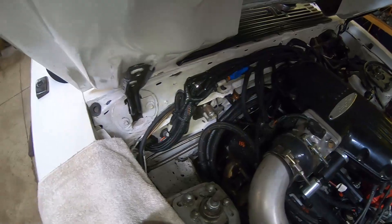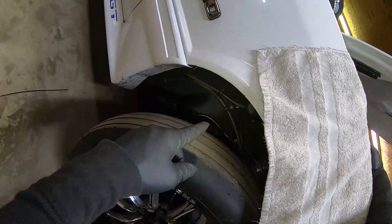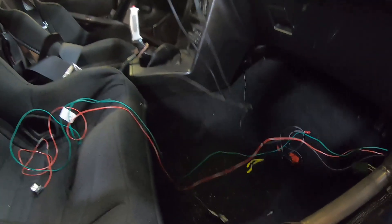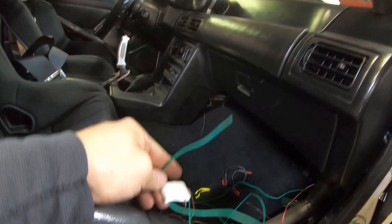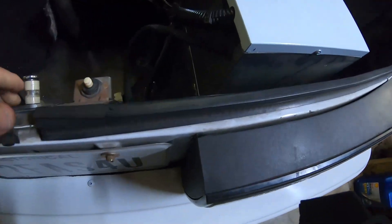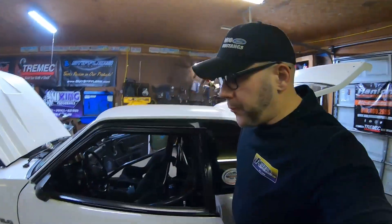Oil pressure — we'll do another low-dollar sensor and run it right here. We have a fuel pressure gauge in the wheel well like on my black car, so we'll run the fuel pressure sensor up here and set it up that way. Got most of the swap installed into the Mustang. Still need to finish up the ignition coil, set the negative ground using the factory ground, run the 12-volt switch to the fuse box, and wire the 12-volt fuel pump. Since I already wired a relay into my aftermarket pump setup, Holley can control the fuel pump right back to the relay I set up as a secondary — so I technically don't need the factory fuel pump relay wire.